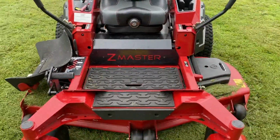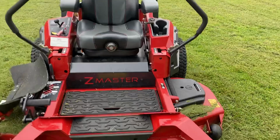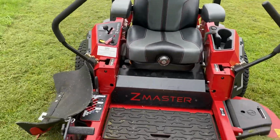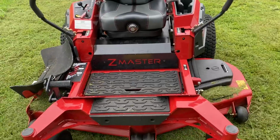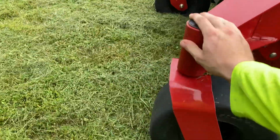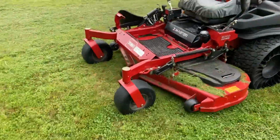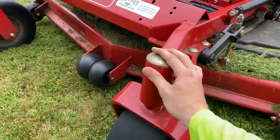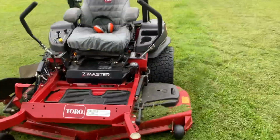And this is on an HGX, so it does have the ZT 4400s, which gives it around a 10-mile-an-hour ground speed with these smaller 12-inch tires. And you can see the front frame here. One thing to consider is these are ball bearings as compared to tapered roller bearings in here, which is not going to make a tremendous difference in the short run, but maybe in the long run, you never know.